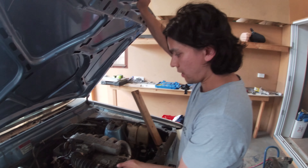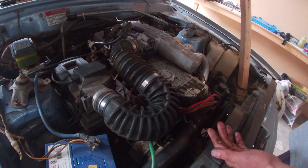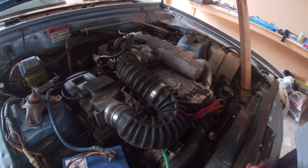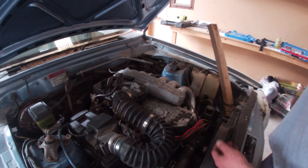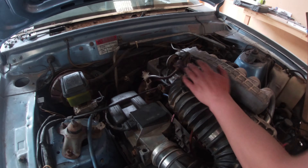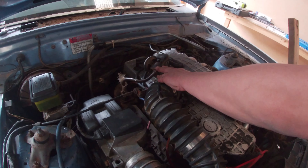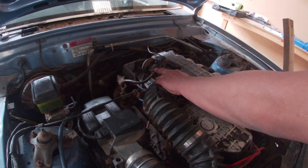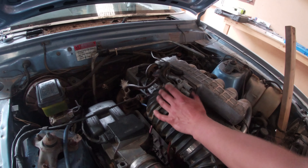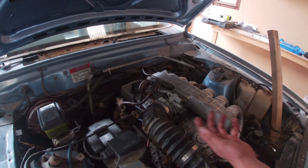So here's the same motor — it's a 250 crossflow, it's an EFI version. There's not as many EFI versions floating around. The XE has this particular motor, which I'm pretty happy with, but you can see there's a fair bit more going on in terms of vacuum lines and sensors and everything, because it's got to have some sort of input into the computer via sensors. There's a lot more going on because it needs to tell the computer exactly what to do and how to function under different driving conditions.